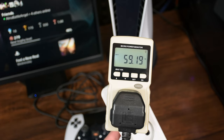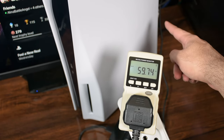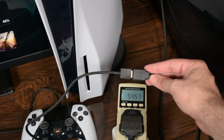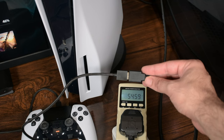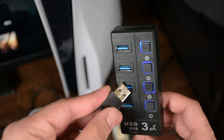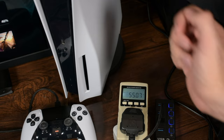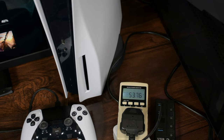Testing the black USB-A port gave the same results, meaning both USB ports provide the same charging speed and sufficient power. The USB 3 back ports also showed the same results when connected directly. However, using a USB 3 extender cable dropped output to only 1 watt, causing lower power and higher delay — don't use extender cables. I also tested a USB 3 hub without external power: the controller worked but only received about 1.5 watts. Using a USB hub without external power means your controller is less likely to charge while playing and may experience higher delay.